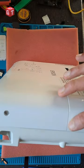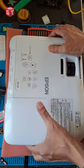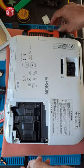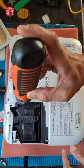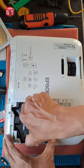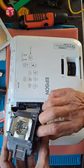Remove the screw, slide the door, remove these two screws, hold it firmly, pull it up. This is the lamp.